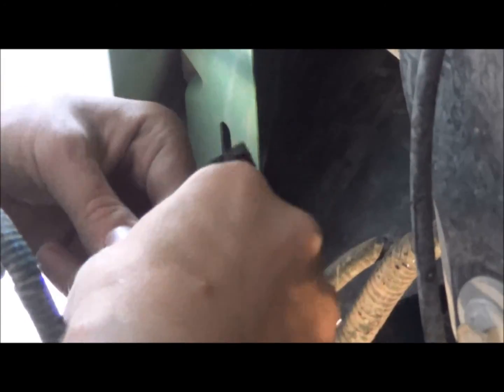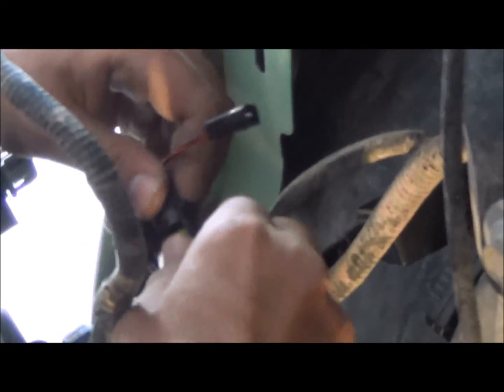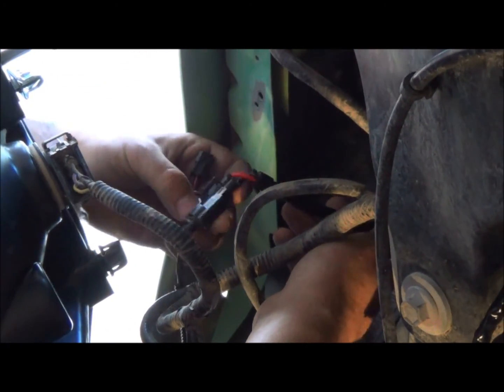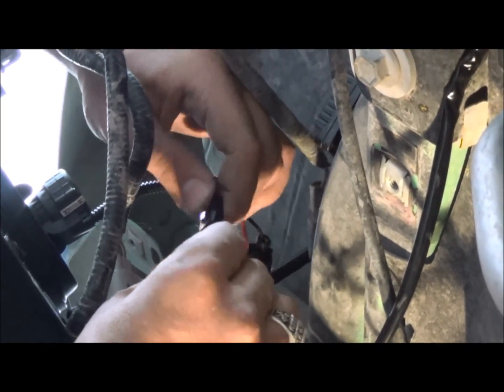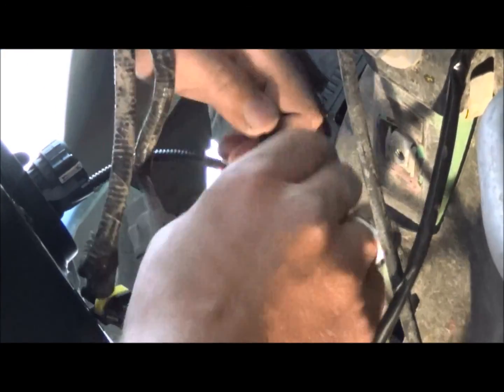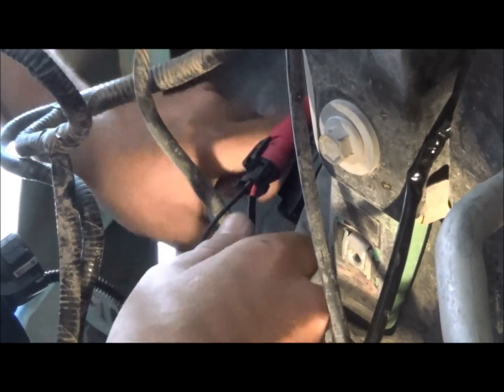There we go, there's that one. And that one's in. And then our last wire — I guess we don't have one of those on this side. Oh wait, it's over here. So then the other one — this little square one actually doesn't come from the ballast, it comes from the wiring loom. It's a little square rounded top, square at the bottom, kind of round at the top. That one goes together. You can take this plug again and plug it into your ballast — the red plug, take the snap. You've got it already hooked up. Take this thing out of the way. Then start slowly putting this in — that little notch right there, you're going to run those wires through it like that, so they can't get pinched anywhere.